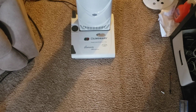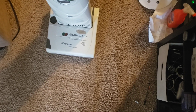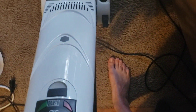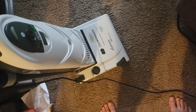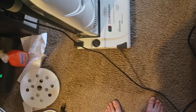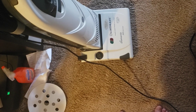They probably perform better than we expect given the power numbers. But if Lindhaus would take some time and make changes — like fixing the narrow hose issue and making the air path better sealed, especially down to the nozzle — that would help a lot. The Advance Spectrum 12P actually got a pretty good rating at the bottom of its nozzle despite also having a 4.3-inch motor, and they just did it a little better.